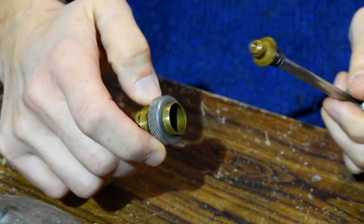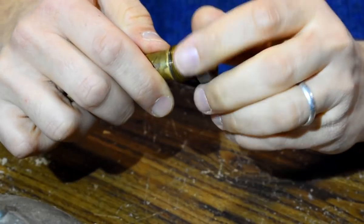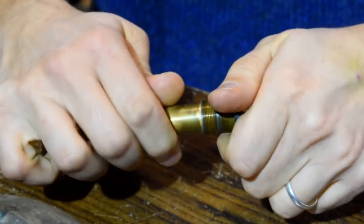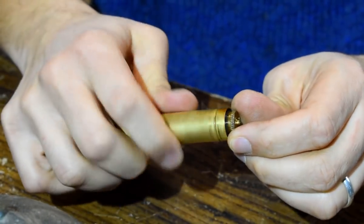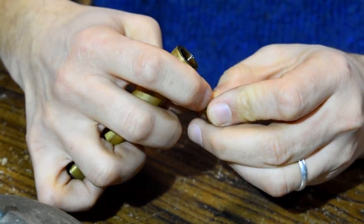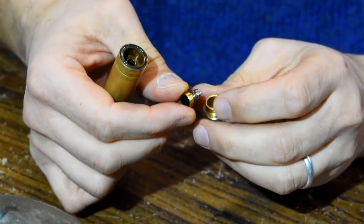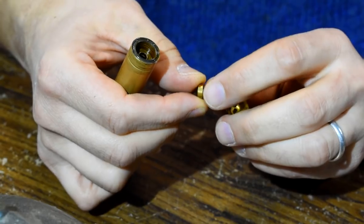This pump didn't come with a pump leather — fortunately, my repair kit includes one. The pump body seals to the fount with a rubber gasket; this one is pretty stiff and will get replaced. The end of the pump holds the non-return valve, or NRV. This is a one-way valve that keeps fuel from going back up the pump. It's got a rubber pip that will need to be replaced, and a spring which is bent up pretty bad and will bite me later on.